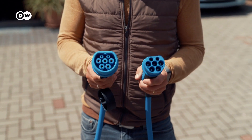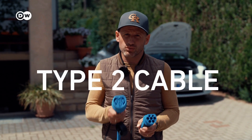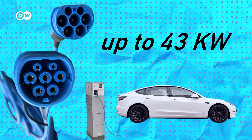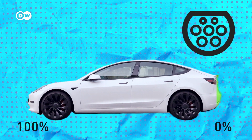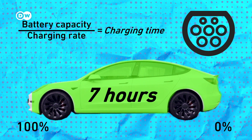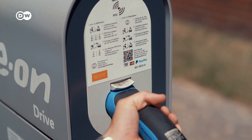This is the cable you get from a manufacturer when you buy an EV — it's a type 2 cable. In Germany, type 2 cables usually transfer at rates up to 43 kilowatts, but it depends on what your specific EV can take and what the public charger can deliver. For example, charging my Tesla's 77 kilowatt-hour battery from 0 to 100 at an 11 kilowatt charger takes seven hours. If you live in a city and don't have your own charging setup at home, this is the cable you are likely to rely on the most.